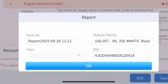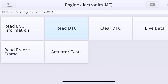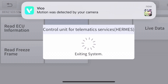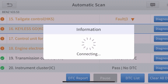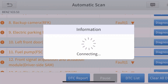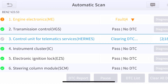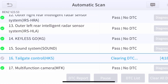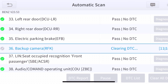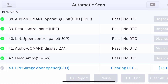Now that I know the major problem, I'm going to try to delete all the DTC codes. Some of them aren't serious — for instance, one just said registration is expired for telematic services. I looked through every one of the faults individually, then decided to clear all the codes and see what happens. I pressed 'clear all DTCs' and it went through codes 1 through 18, clearing each one. Everything cleared except for the top three.